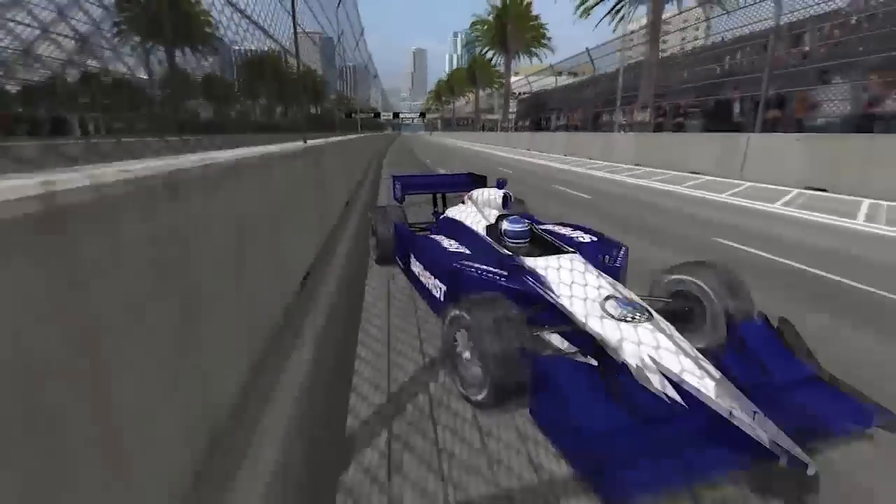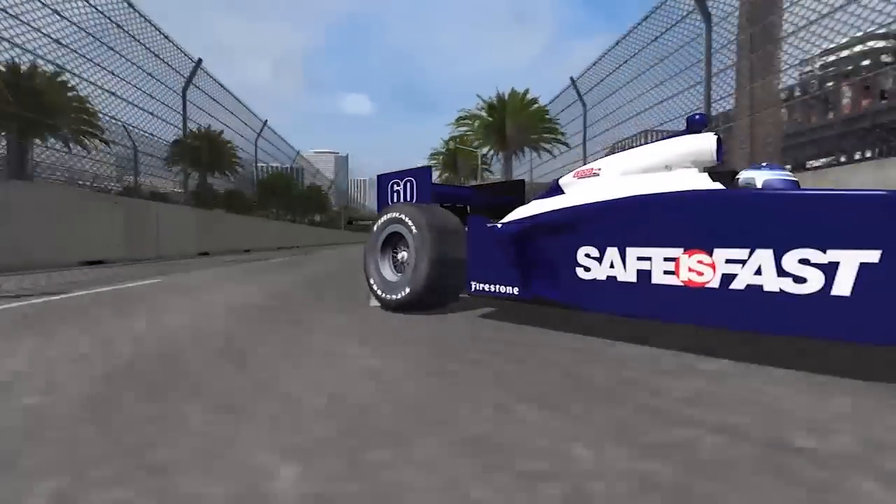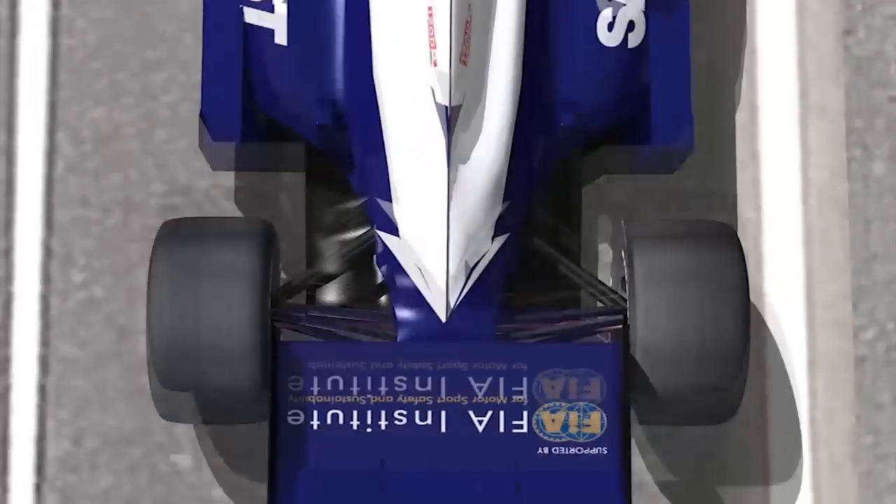What's the ideal setup? Normally you'd set the front toe with a little bit of toe out. That makes the car roll nicely and freely, and it enters the corners a little bit more easily, because if you toe in the front, you have to fight the steering across center before you turn in.